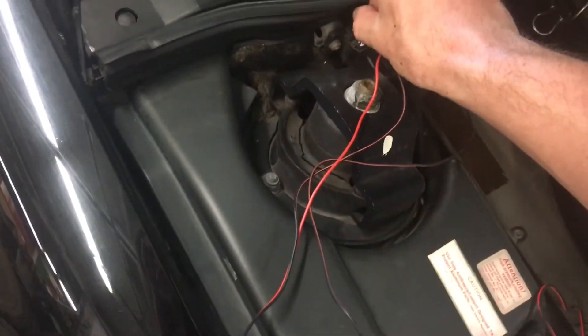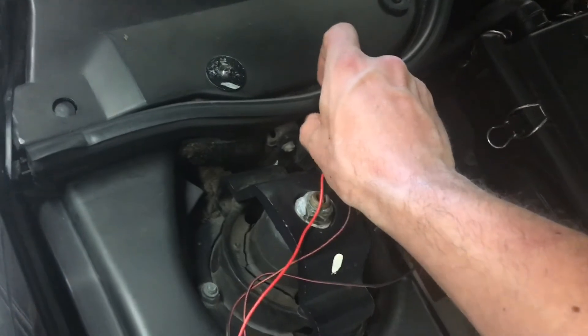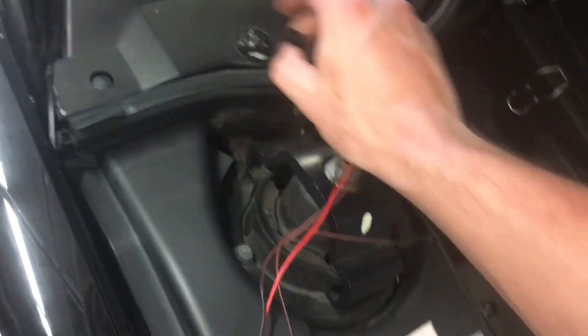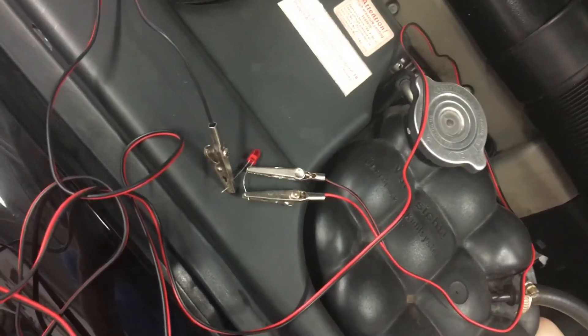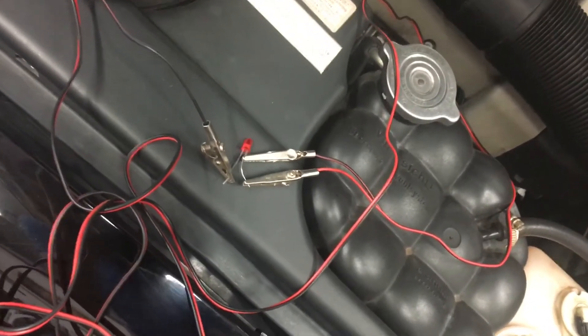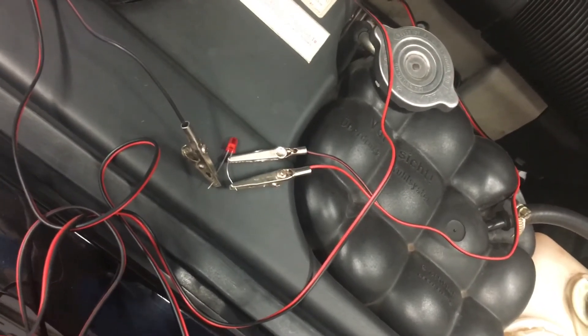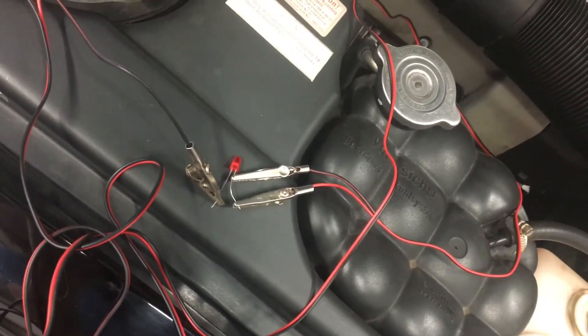Back at the car — I still have the ignition on, and I already read the codes once with you. Normally I would go straight to the clear procedure, but you have to read this code twice. So I put the banana plug back into slot 1 for three seconds, then go back to reading. The codes confirm as 28, 29, and 30.